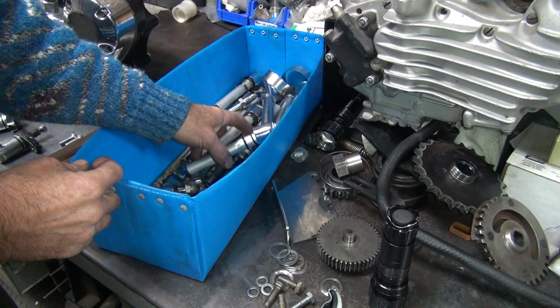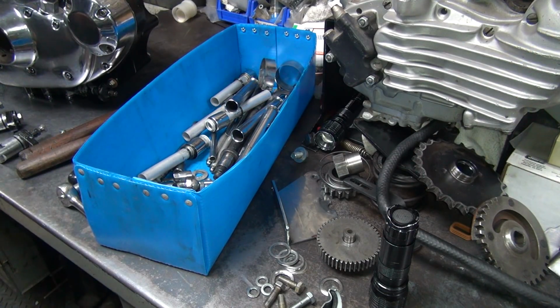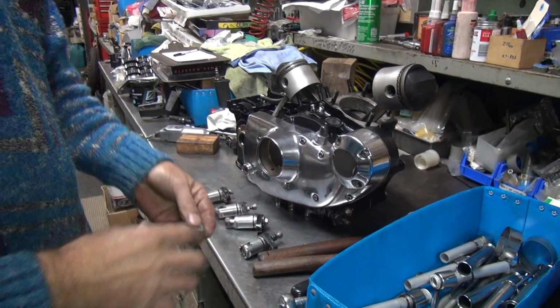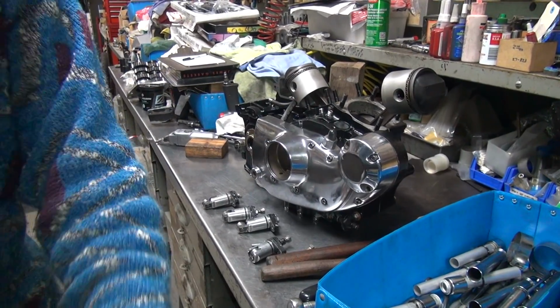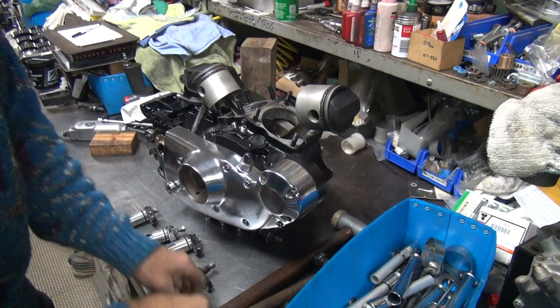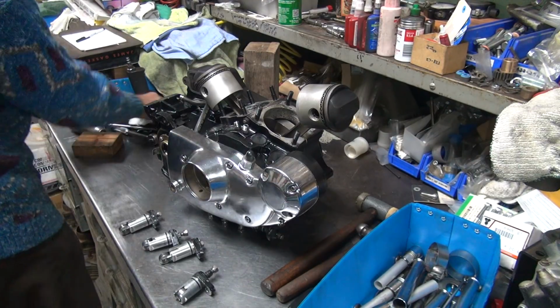Alright. Triple check. No other bolts. Okay. Be back in a second. I'm going to find something to put in the hole. Alright. This will be a temporary bolt. The air cleaner goes on number 3 adjuster there. So that's where we're going to put it. There, get back up, you can see it better. And put the air cleaner in there. We'll just pull out that bolt and put the correct one that goes in there. Usually it's a double-ended stud that goes in there, but appears to not be here right now.